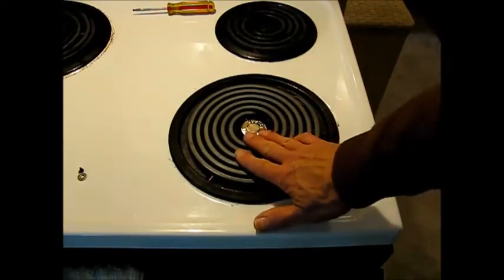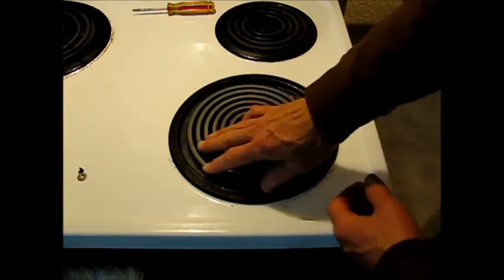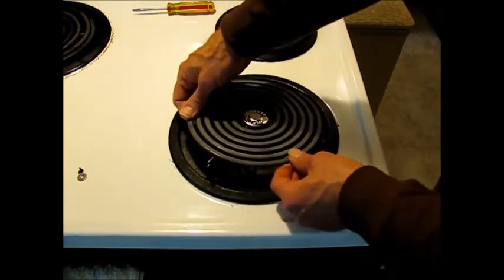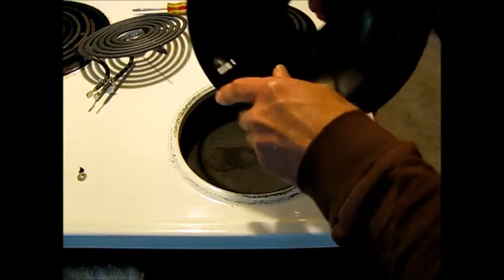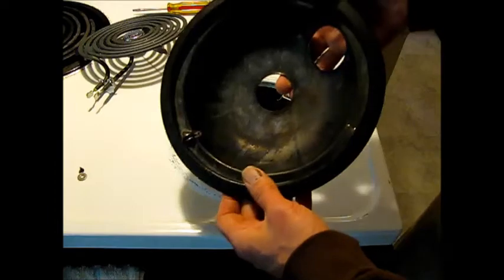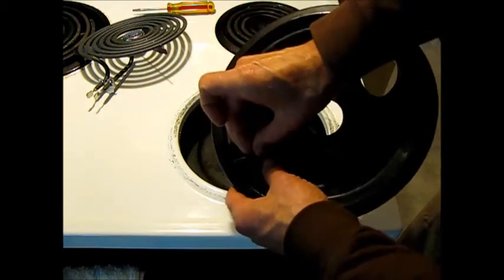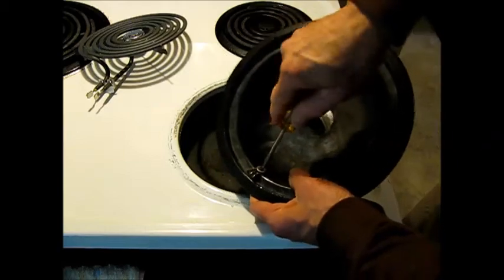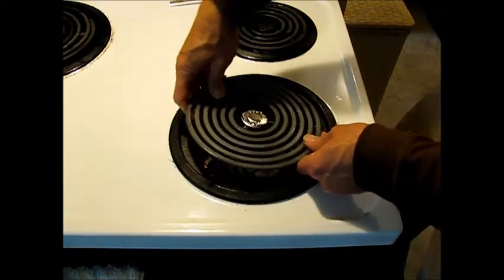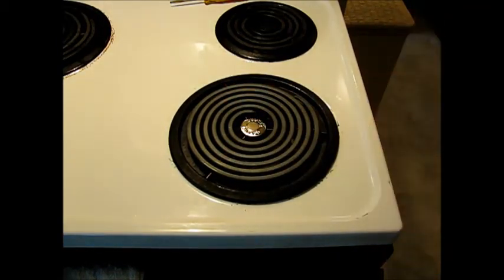There's a little sideline item here. I want to show you a remedy for a little phenomenon I call burner sag. If you look at this burner, it's tilted. Because over the years as you're putting a lot of heavy kettles on here, this support cuts into the groove of the drip pan, creating a deeper groove so the burner sits down lower. What I did is drill a small hole in this pan and put a washer and a sheet metal screw in there. The idea is this builds it back up to its original level, so when you reinstall the burner it rests on the washer and sits level — so fluids like grease or oil won't go to one end of the pan.